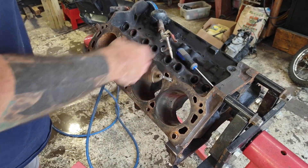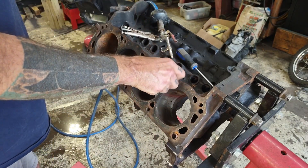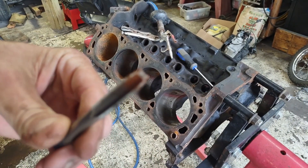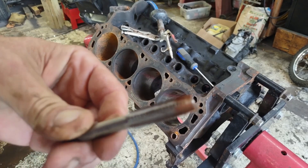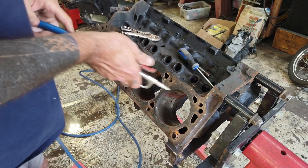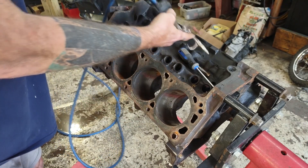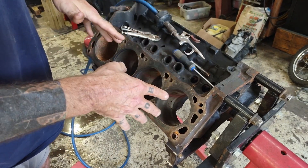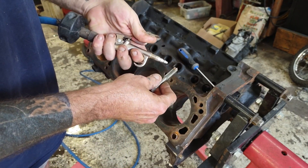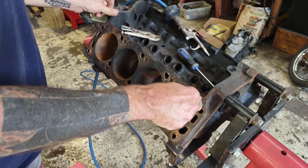Come back up — that's where it stops, that's the bottom of the hole. Bring this all the way back out, take it out by hand, and we can look at the bottom of the tap. It's got a bunch of rust in it, no large particles, no chunks, so now I want to blow it out again. You saw the puff of rust coming out, which means we went in there and cleaned those threads out good. Before I run this tap down the next hole, clean the tap up so it's all nice and clean — no need to put one hole's garbage down another hole.